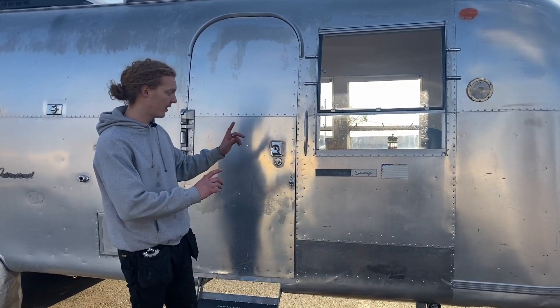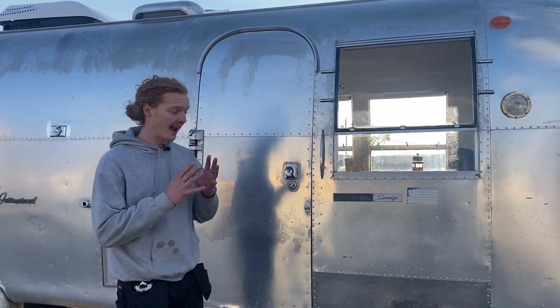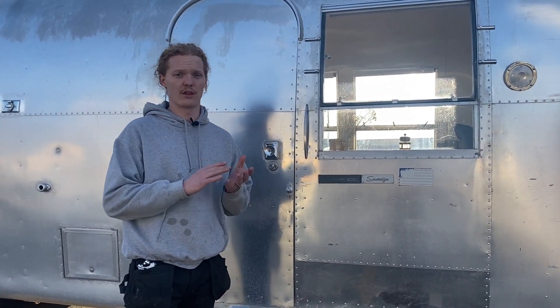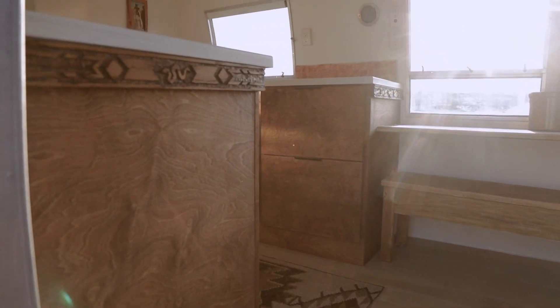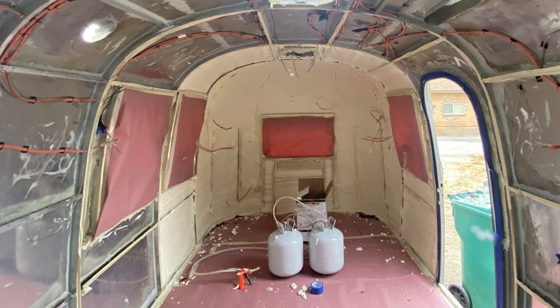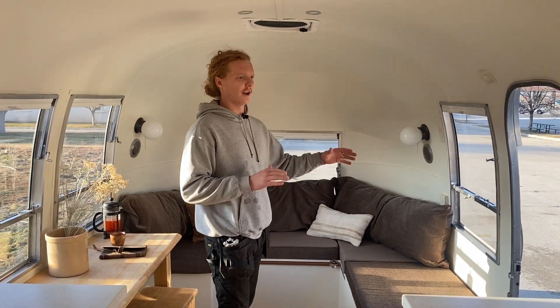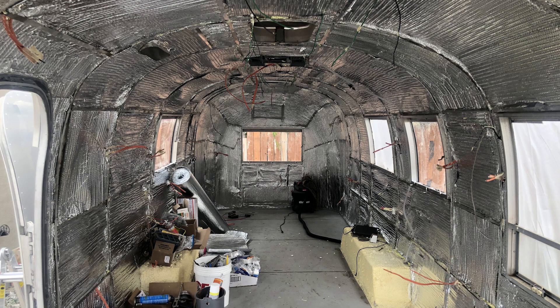We've gone over the exterior and now we're going to go to the interior. But before we do, I just wanted to touch on something you've probably seen on the ad: we built this to be four-seasonal — we actually bought and started building this to live in ourselves. Airstreams give you about two inches of width between the outer skin and inner shell. For four-seasonal living, we went with Tiger Foam Closed Cell Spray Foam, which has an R-value of about seven per inch, so we've got about an inch and a half to two inches, with another layer of Reflectix giving a couple more R-value points — super-duper insulated.